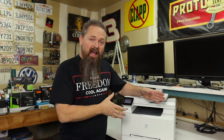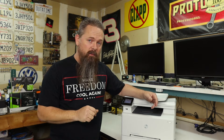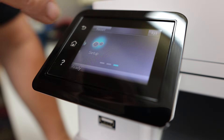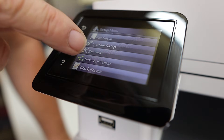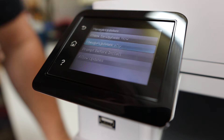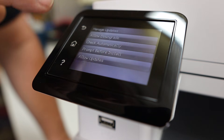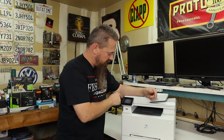Now that we have this flashed with the older firmware, we have to make sure it doesn't update its firmware the next time it checks — or the driver on your computer can actually send a firmware update to the printer as well. To prevent that, scroll over to Setup, then scroll down to Services, then scroll down to LaserJet Update, click Manage Updates, and change Allow Updates to No. Once we change it to No, hit Home — and that's it. It shouldn't even attempt to upgrade your printer from this point forward.